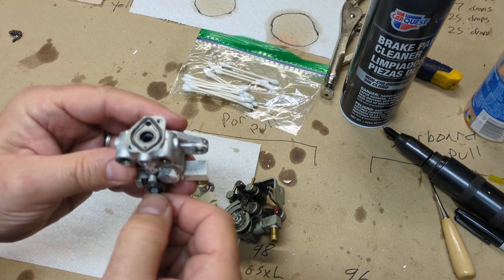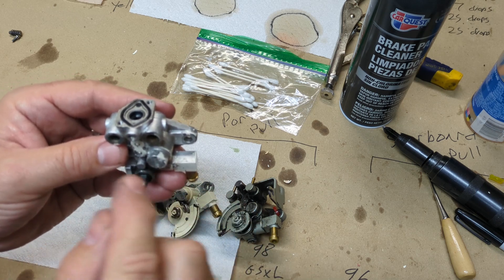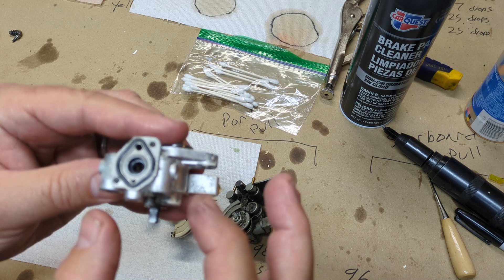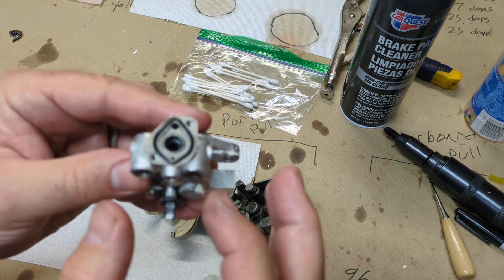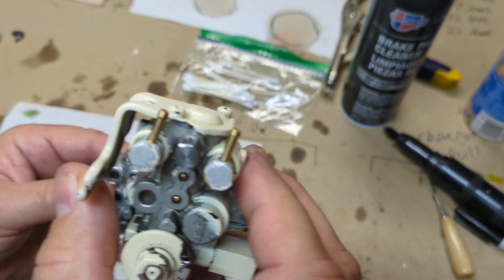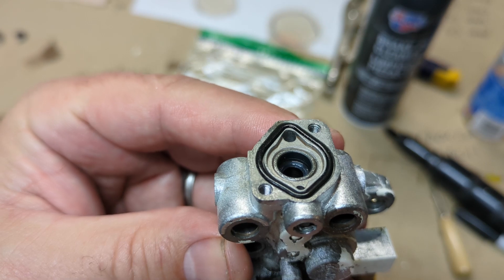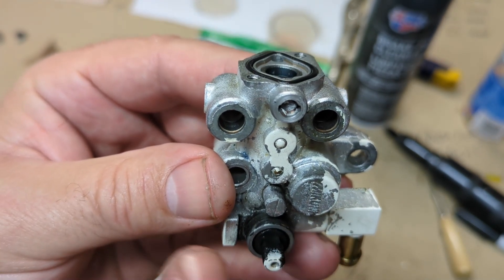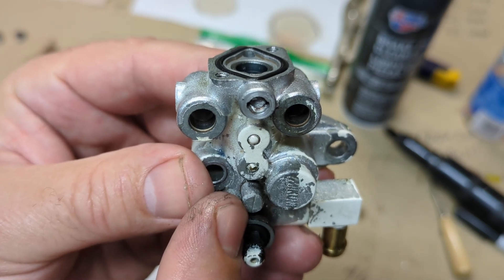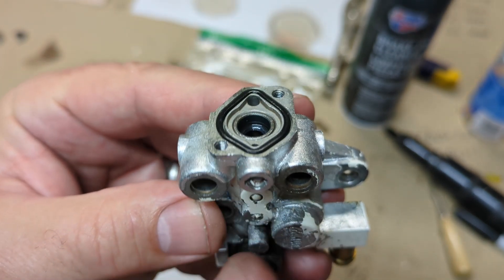It's not that this goes up and down equally with a revolution — it's not symmetric. It's very juxtapositional with the orientation of the shaft. The up and down motion of that is what controls the intensity of the pressure and the flow that comes out of these two channels here. Right now it's at top dead center — this is a D shaft, so it's flat on one side, and right now it's facing straight up. That's also what these oil marks refer to.